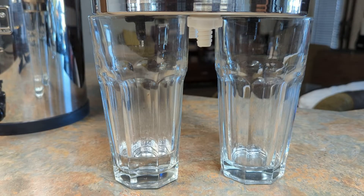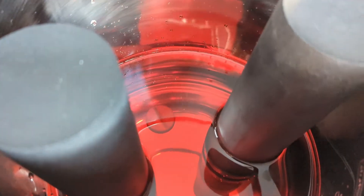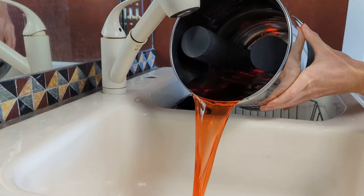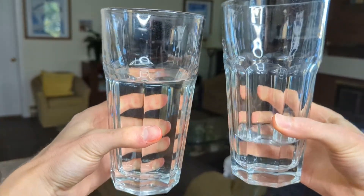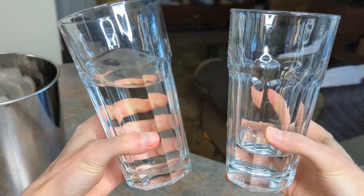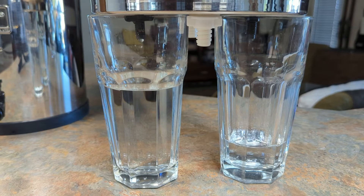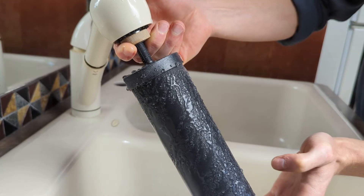Once you've collected enough water to fill two-thirds of the glass you're using, you can go ahead and discard the remainder from the top reservoir. The filtered water should be clear without any pink or red tint at all. As you can see, one of the glasses in my test filled up a lot faster than the other. This indicates that the filter with the slower filtration rate either needs to be cleaned or re-primed.